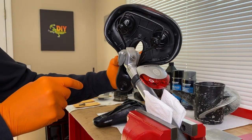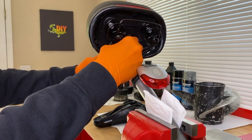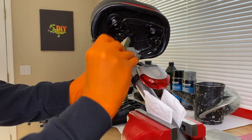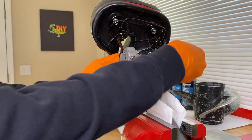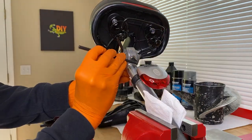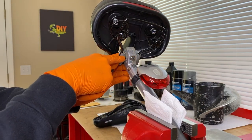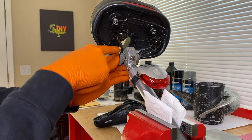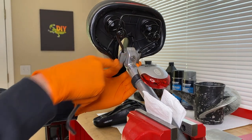I may be able to maneuver it in place as I was able to remove the other one just by wiggling it. And there we go. From here, I'll grab that allen key and tighten it. As you tighten this, just ensure that you are tightening it evenly and not crooked. Every couple of turns of the internal bolt, realign the seat with the bracket or mount and continue tightening. Do not over-tighten this, but you want it snug.